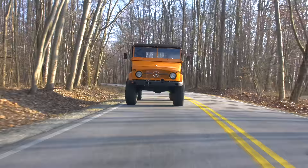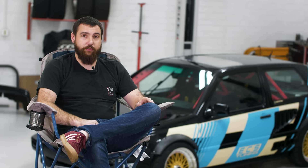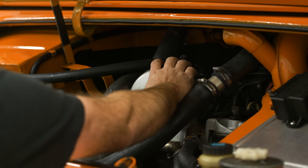These would have also had just manual steering — that's why it's got the giant steering wheel — and manual brakes, just single-line master cylinder stuff. Now it has hydro boost out of an E28 M5 and a Chevy Astrovan steering box, so I could put power steering in it. It's reasonable to drive now; I'm not constantly panicking. Quite a bit more power, but it took quite a bit to get it in here.